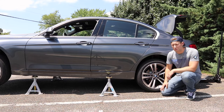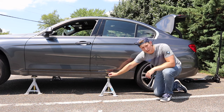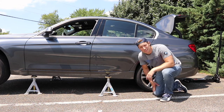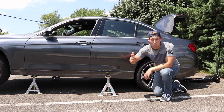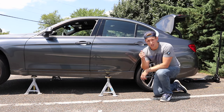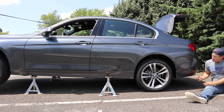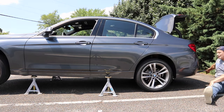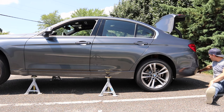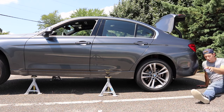We've successfully done the front. Now make sure that you have your jack adapters on your jack stand and put it right where it needs to go — get the car up, put it on, then take the jack out and you're done. We'll go ahead and put it on the differential. Make sure you put it in the correct spot. The differential is pretty far under there, so a lot of times you're not going to be able to get a full pull out of your jack — you'll have to have it at a pretty low angle and do it a little bit at a time. That's perfectly normal.